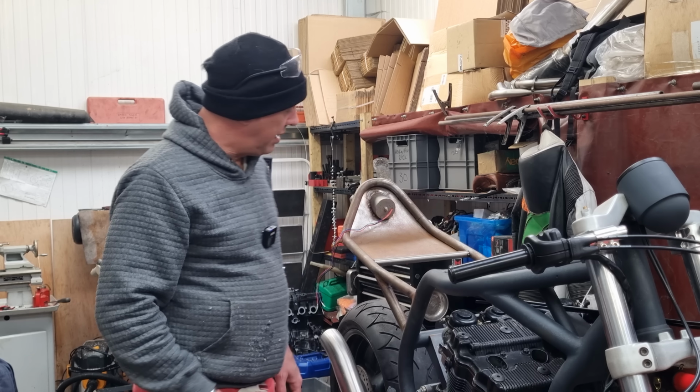Essentially, there is very little that I can grab hold of on here. So I ended up making a plug, which I've knocked in the end so it's a bit more solid, but I'm still only grabbing hold of a little bit, just because of the way the jaws are on the chuck. But we've basically got them squared off, or as close as I'm ever going to get it. It was all dialed in, so it's not going to be far off. I measured them up and there's 0.2 difference, so that's all fine.